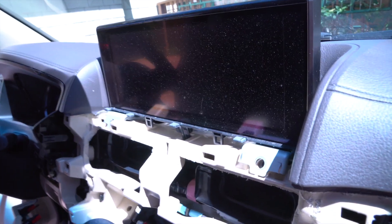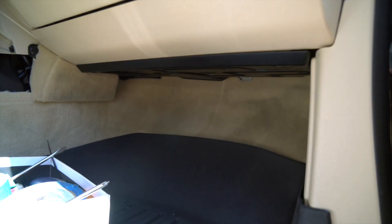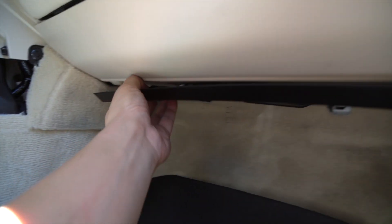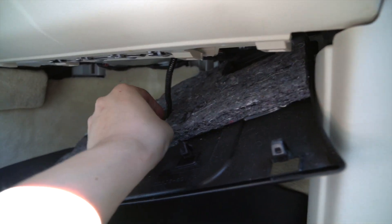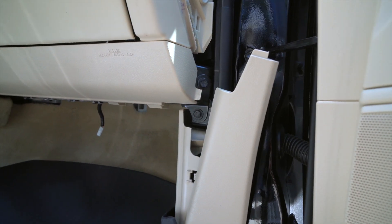Now let's go ahead and unbolt these two 10mm bolts. Once you have those unbolted, in order to remove this go ahead and pull it up. But for now let's leave it and work on the glove compartment area. We're going to start off by removing this piece over here — there are little tabs you can push, one over here as well. Just push the tab and push it down, and it'll just drop like this. Then remove this connector and put it aside. Be careful not to close your door when it's out like this because it could damage it. This exposes these two 10mm bolts that we're going to remove.